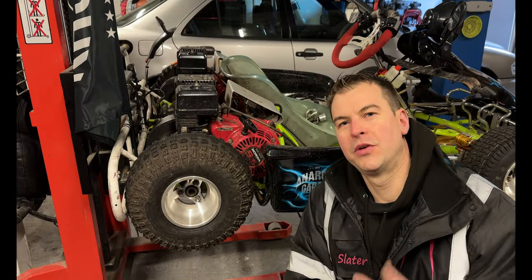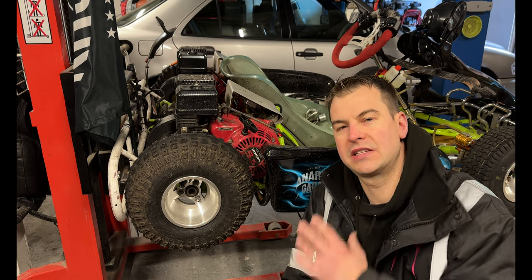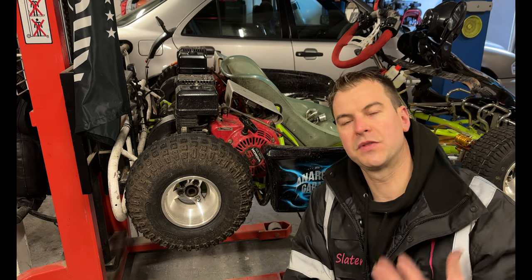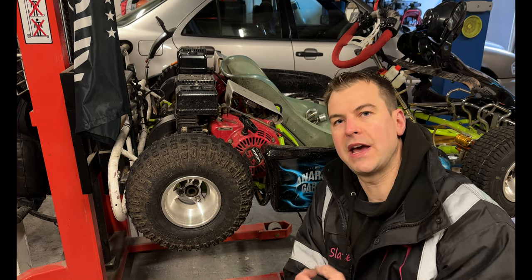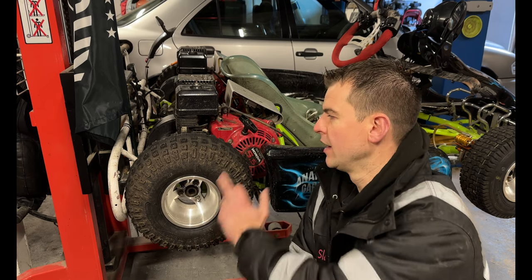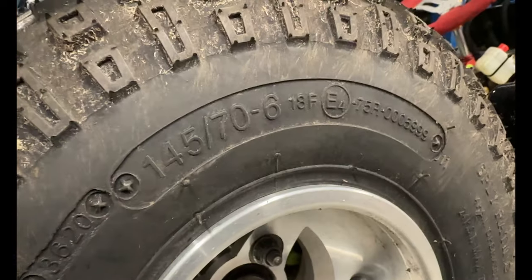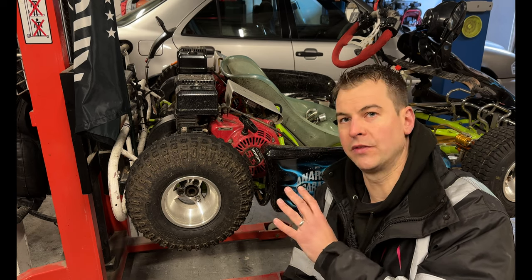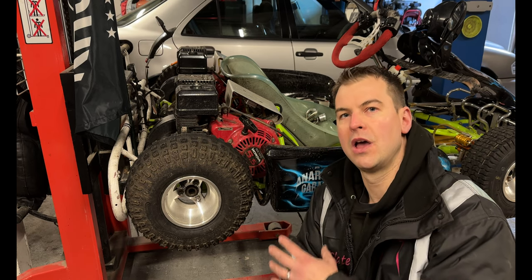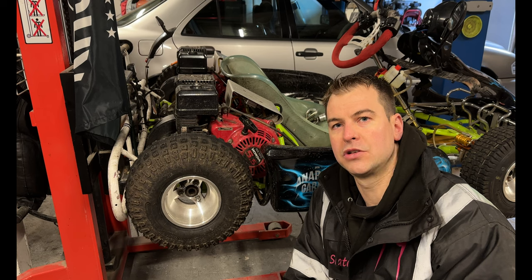The other thing to go through again, which is mentioned in the earlier episodes, is wheels and tyres. We are actually running 6-inch wheels on these, and because of the brakes on the front, we've had to use gearbox kart wheels all the way around. The reason for that is these have 3 bolts in the center, and the tyres themselves are actually off an LT50 quad, so they are E-marked again. E-marked, road legal tyres are everything for one of these because there are not a lot of them around. We're also looking at other tyre manufacturers and other sizes, and we will be featuring those later on because we've got another manufacturer we're going to try out for these.